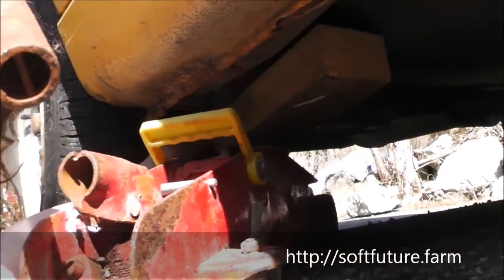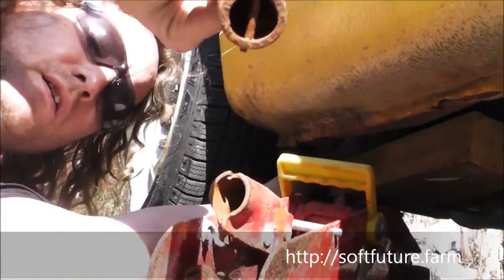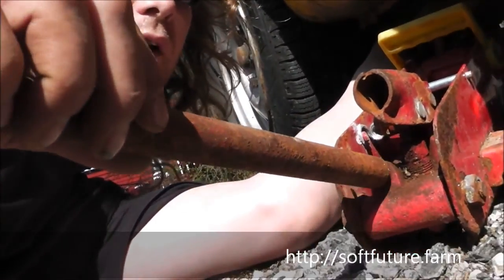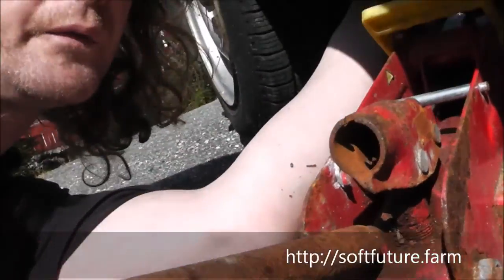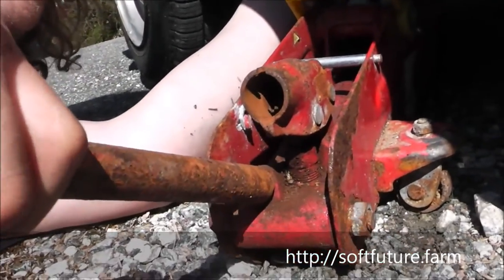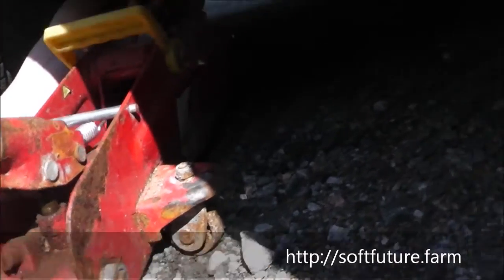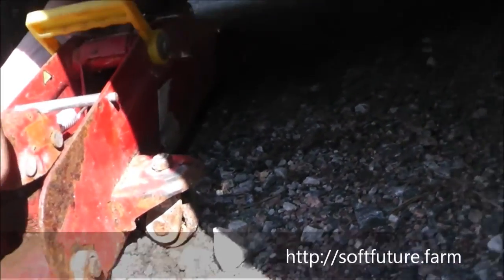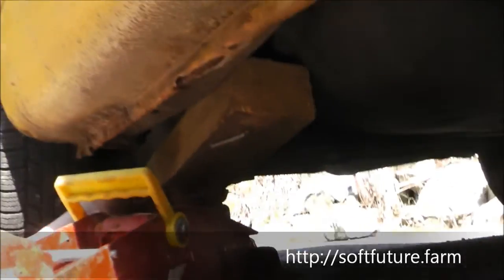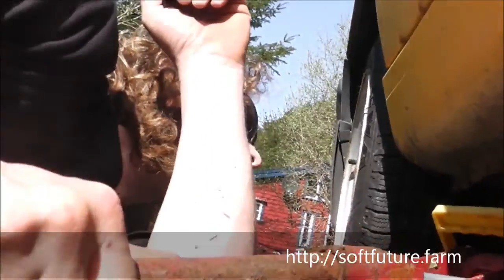When we're using this jack, you have this point here on the handle of the jack, and you have this screw right here. To tighten it, you screw it clockwise, and now you can start jacking it up. So you put the jack under the wooden piece that you found, and you just start lifting it.